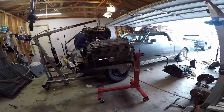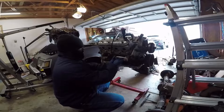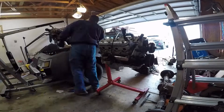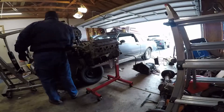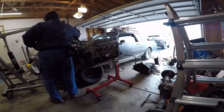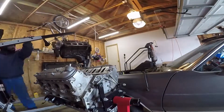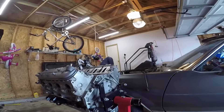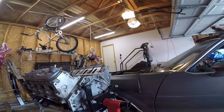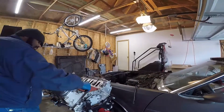Right here I was taking the engine mount off the 5.3 that was in the car and putting it on the other one. A lot of people like to use the Edelbrock mounts — these are just adapter plates with the Chevy clamshells, and they worked out pretty well for me. At first they gave me a lot of issues with fitment, but it came down to my frame mounts being too tight. I needed to loosen them up so I could have a little bit of movement to jimmy the bolt in to lock everything down, and then I came back later after the bolt was in and was able to tighten everything down.